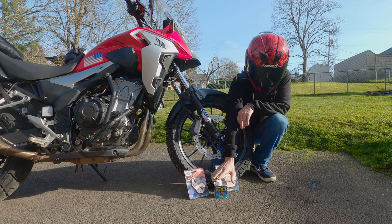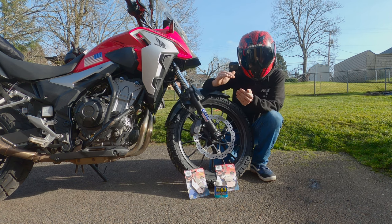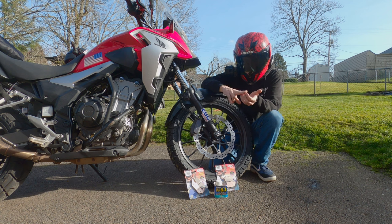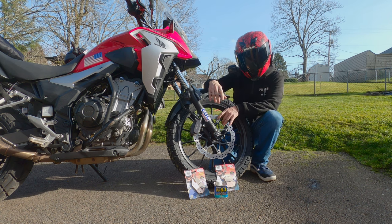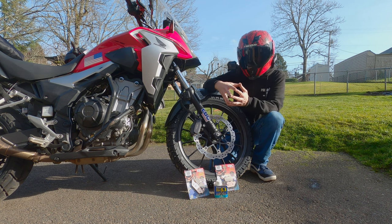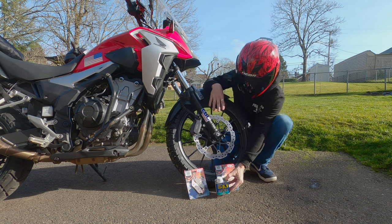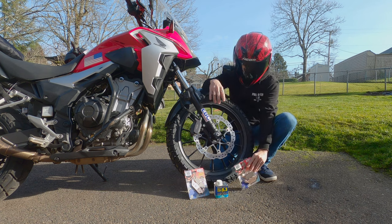The other thing that's great about this fluid is it has about a 40 degree Fahrenheit higher boiling point than DOT 4, which means you're going to have less brake fade given the same situations. And when you have a single disc rotor setup like this, I believe that's pretty important. You don't want to experience brake fade, and running this fluid in your motorcycle will help with brake fade right out of the gate. Couple that with some good quality brake pads, and in my opinion this is a really good